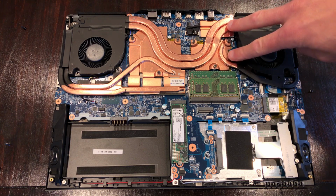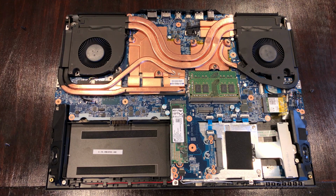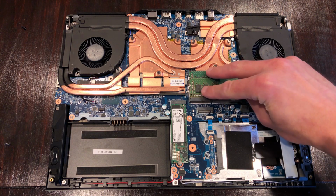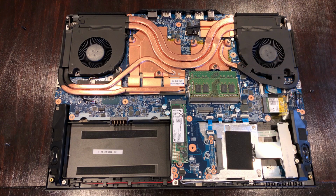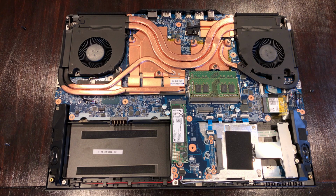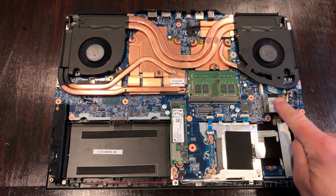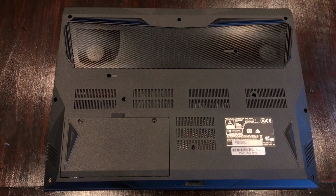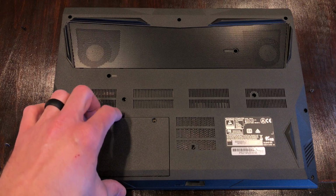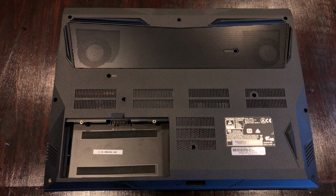We got the 8750H, we've got an RTX 2070 115 watt variant, not a Max-Q, 16 gigabytes of RAM and dual channel 2666. We've got half a terabyte of storage that'll do 4-lane NVMe or SATA. The second M.2 is 4-lane NVMe only. You have space for a 2.5-inch drive as well. And the network interface card I spec'd out with a 9260. And the 62 watt-hour battery is good for about an hour and a half to 4 hours, depending on the graphics mode you have selected.